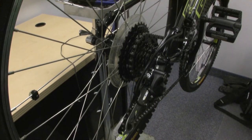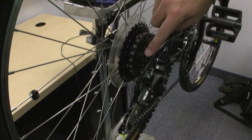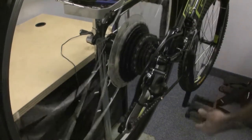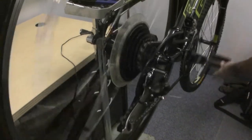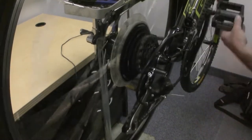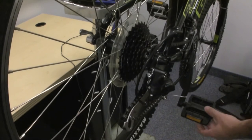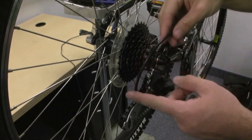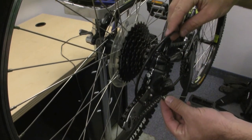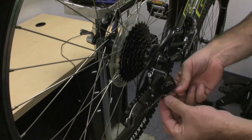I want to give you the basic parts of the rear derailleur shifting system. So we've got several things here. This is the cassette, which has all the gears, and the chain moves over that cassette. As you shift, you can see the chain move up and down the cassette into your easiest gear, which is the low gear, and down into the smallest cog, which is your high gear. You'll also notice this loop — that's the housing here that houses the cable and protects it. And that comes here to the crimp bolt, which holds that cable. You want to loosen or tighten that whenever you need to hold this cable tight.